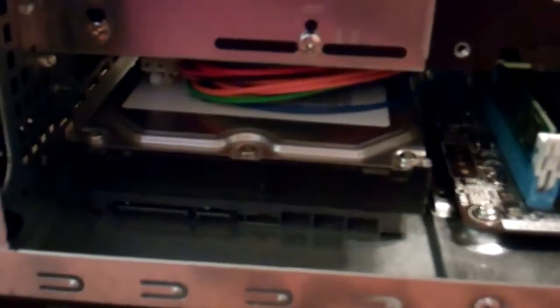I'm still having a dilemma — these brackets are just too large to mount either on the side or the underside because of the space constraints. The hard drive is just sitting on the bottom, which is not good. So I may have to put some spacers in there and just mark the holes on the underside of the hard drive to run screws through. I'll drill through the bottom and put spacers in there to get the circuit board off the bottom of the case and mount it that way.